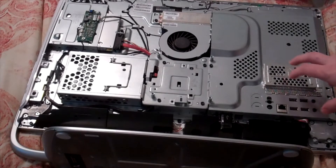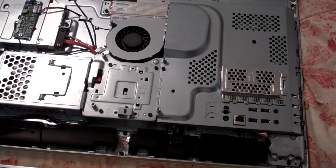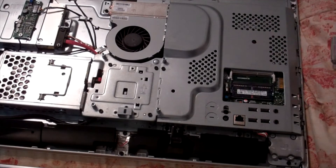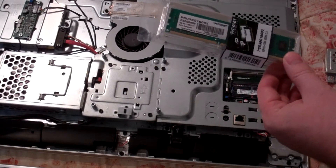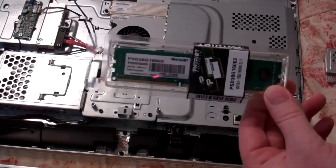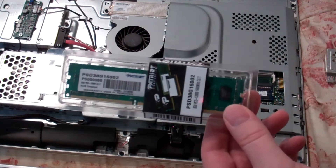To access the RAM, that's right here. Let's go ahead and take this panel off. Now we'll pull this panel off — it lifts off real easy. And there's the RAM. This is SODIMM RAM, and you want to find the correct type and order yourself another stick. This is an 8GB stick that's in there. I made the mistake when I was ordering — I accidentally ordered the wrong type, even paying attention and trying to be as careful as I could.